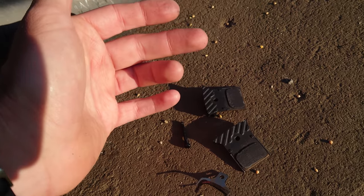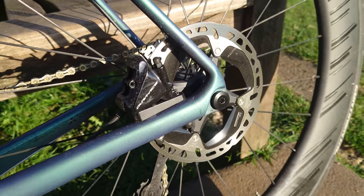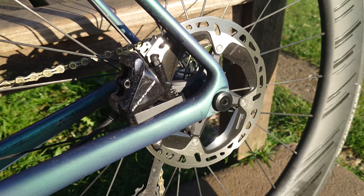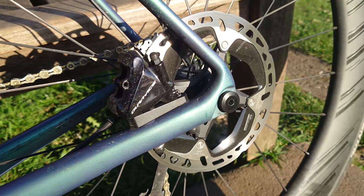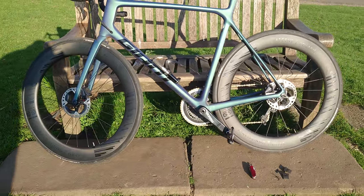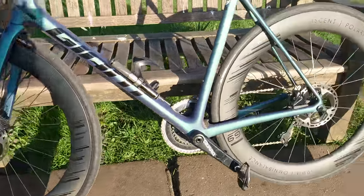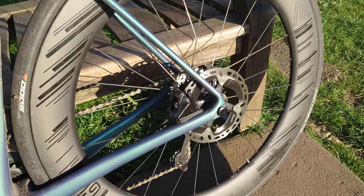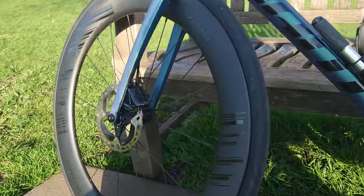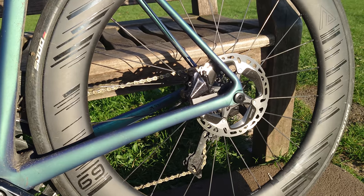So these need replacing — they're six months old. There are no bike shops around here, so I can't ride now until I get new pads because otherwise I'll damage that disc prematurely. It's probably only got three months in it anyway because it's halfway through the wear guidance on the vernier caliper. That is the reality of riding a disc brake bike hard. If you're heavy and you ride in a lot of hills — which you would, because that's why you bought a disc brake bike — it's an expensive business. Obviously there are cheaper discs out there, but if you're going for top-end stuff like Dura-Ace and XTR, you expect it to last. What's the warranty on an XTR part? Three years instead of two? What's the point if these are lasting six months? It's just not built to last.